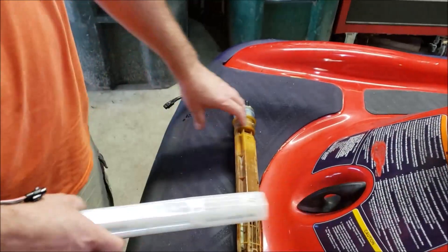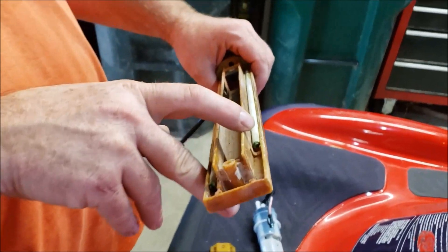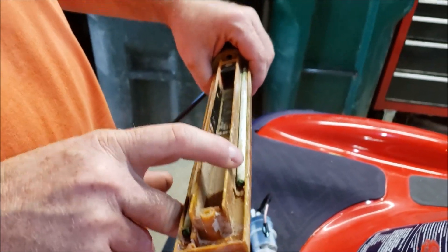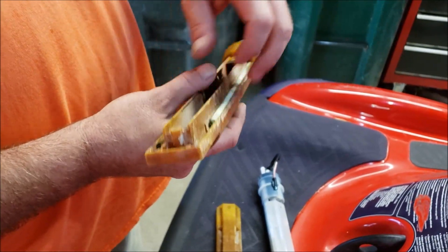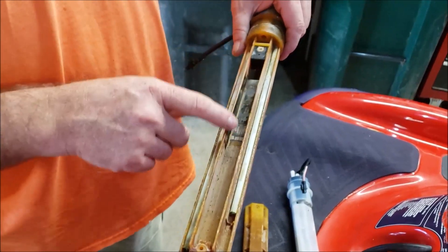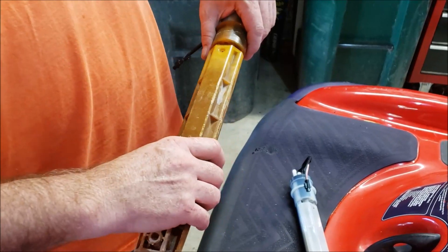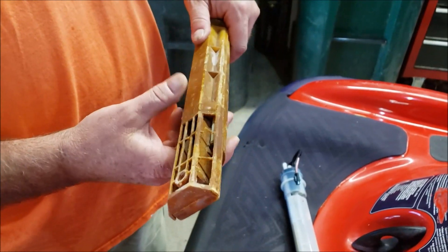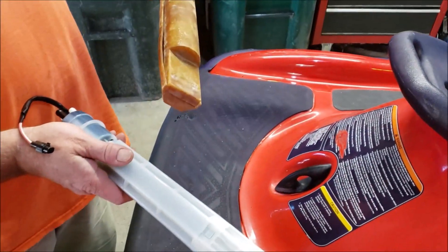The other crazy thing is that we couldn't even pump the tank out because both the main and the reserve tubes are completely blocked with green scuzz. These tubes are some kind of copper alloy and they're just Statue of Liberty all through the tube — completely. The float for the fuel level was just sticky and nasty, so there was really no choice but to replace this. There are used ones on eBay that look a little better than this, but not a lot better. Note to self: they're supposed to be white — brown ones are to be avoided.